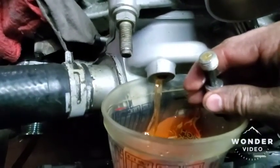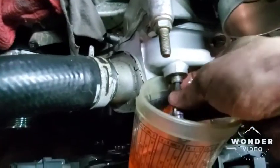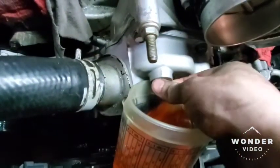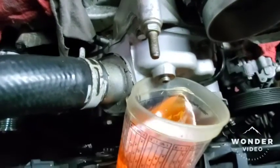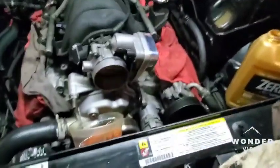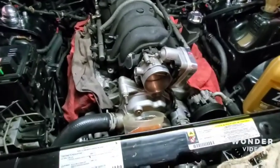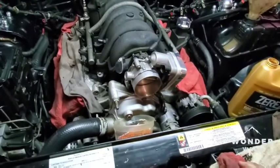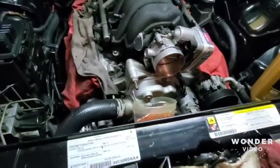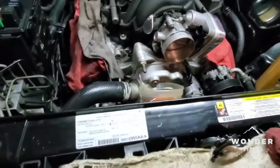You're looking for a solid stream of coolant to get all the air out. See that? That's a pretty solid stream — you don't want any drizzles, bubbles, or air pockets in it. Then put your plug back in and tighten it up. That's basically how you do it. My personal preference is to also start the engine, let it heat-cycle through, turn it off, let it cool down a bit, then pull the plug out and bleed it a couple more times after it's heat-cycled.